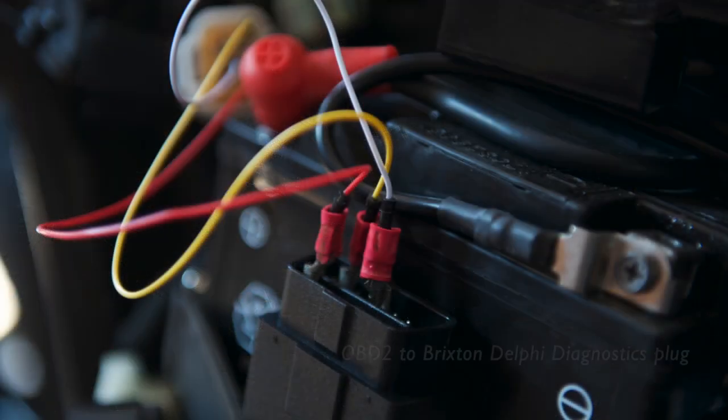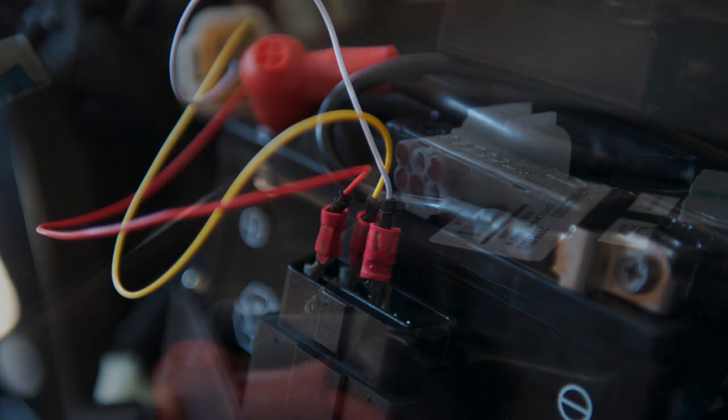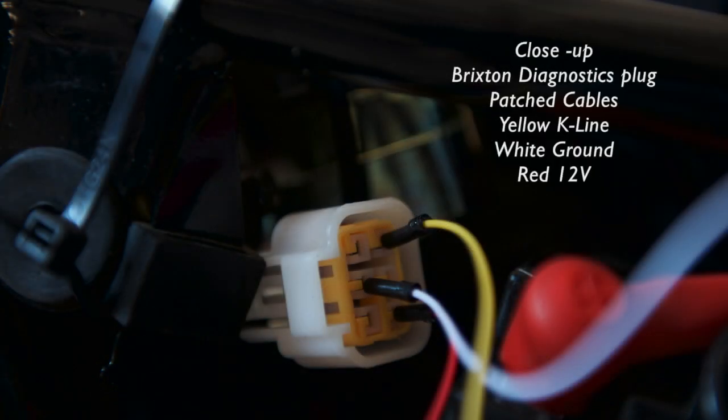All right guys, you've seen now how you can read out error codes on your bike, and how you can clear the error codes. You've seen me disconnecting a sensor, then you saw the fault being stored, then we saw the light on the display that stayed on, we then cleared the fault and then the light disappeared. So you can check RPMs, temperatures, you can check the sensor. I showed you a little demonstration with the gas throttle on how you can verify that all that is working. So that tool is a very handy little tool.